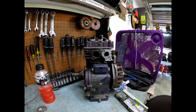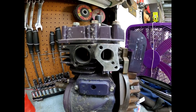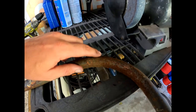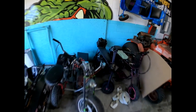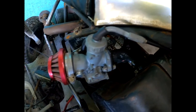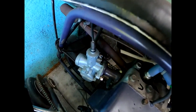This will pretty much work on literally any little small engine that you want to put a different kind of carb on, if you want to make an intake like this. I got my two washers here, and then I have a piece of pipe that I previously bent a 90 in. I'm going to cut out a three-inch chunk — three inches is about as far as you want it to be away. We're going to do a little kick so it'll get his mini bike motor going. On this bike here, this one's more straight. But this one I did more of a kick — that's a 32-millimeter Mikuni on an 8-horsepower. I made both those intakes and they both work great.